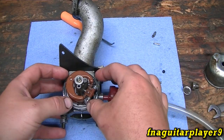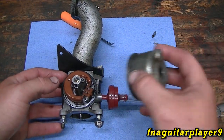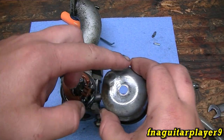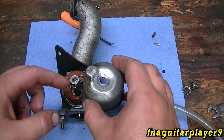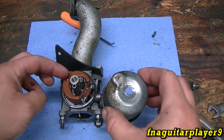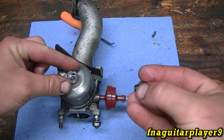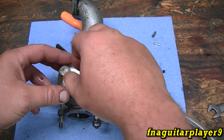Put the ring on here. If you're cleaning the carburetor, make sure you take that ring off and any other rubber parts. You see this bump here — I get asked about it all the time. Sometimes you can actually see a raised part in the shape of the float, and it always goes to the bottom part of the float, opposite of the needle valve. You usually have a washer here — this isn't the exact right one but it seems to be working — and then your bolt.